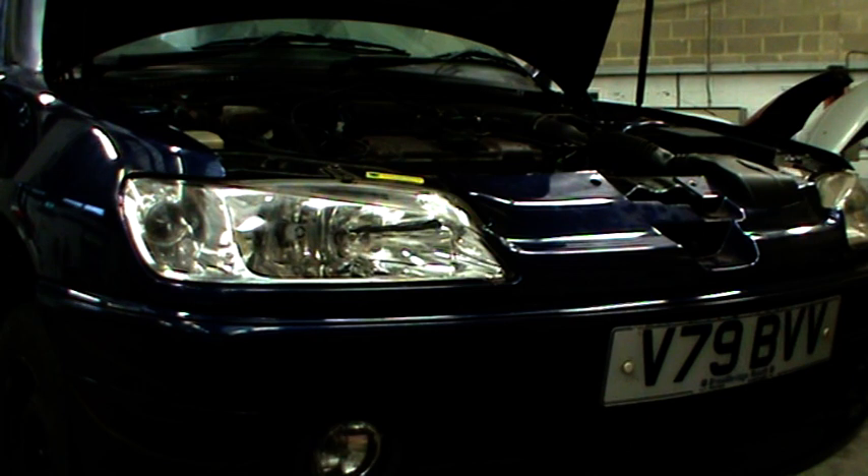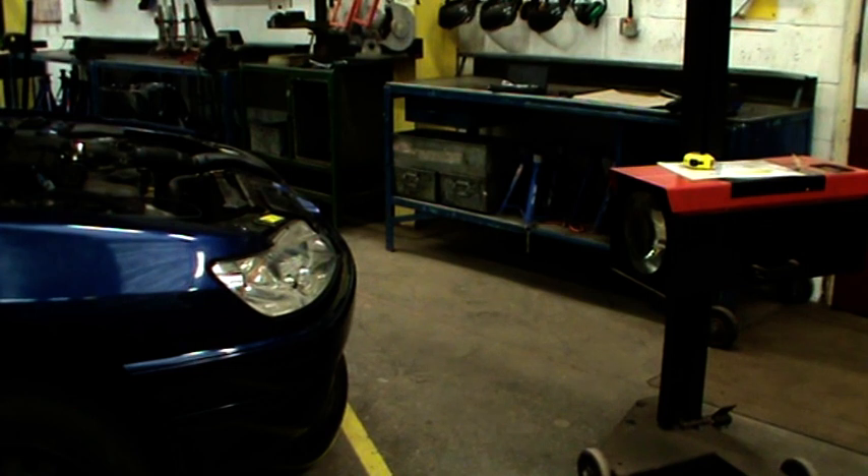The last thing remaining to do is the actual headlight alignment. Although the headlight has got plastic pegs and lugs so that when you push it back into its aperture it is located pretty accurately, there is just a possibility it's not 100%, so we do need to do an alignment check. Pre-checks on the car: make sure the suspension is serviceable, the ride height is equal both sides, make sure the tyres are properly inflated, there's no uneven weight in the vehicle that might upset the level of the headlight, and also make sure that the headlight levelling system is set to zero. Then you can go ahead and check the beam pattern.